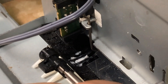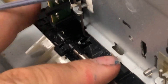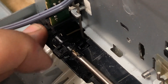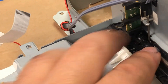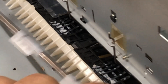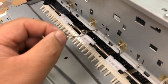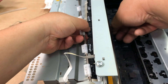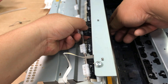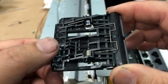To install it, you can push down the plate first and then slide it in. Push it down, slide — there you go. For this video, I'm just going to slide it out, do my demonstration, and put it back. This is called a UPG torsion spring — upper paper guide torsion spring. I'm going to get a hold of the shoe on both sides, lift it up and slide it out. This is called a UPG assembly — upper paper guide assembly.